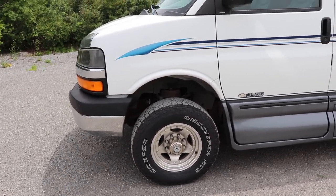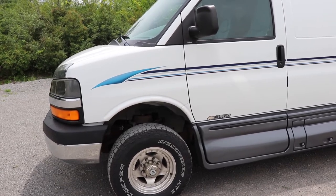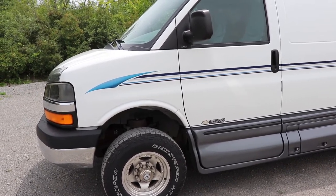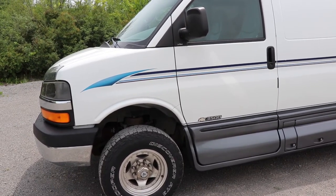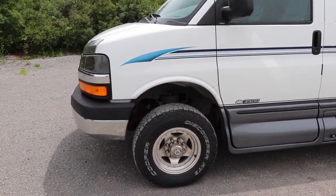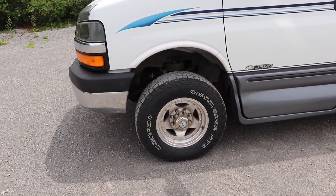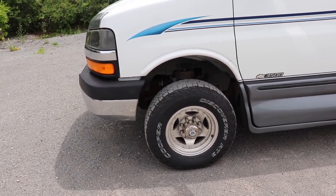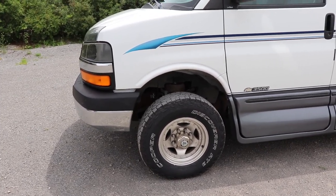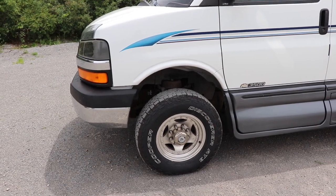Luckily I didn't blow the tire up, and I'm glad I didn't ignore it thinking it would be fine for another 45 minutes — if I had continued on the highway it probably would have separated and possibly caused a crash. That's one thing to keep in mind: when you get a new vibration, deal with it right away, at least investigate and figure out what it is. As for the steering column bushing, it turns out this 2005 Chevy Express doesn't have it. Make sure your suspension is tight — the garage found the lower ball joint is starting to get a little bit loose, so I'll have to deal with that. Thanks for watching.